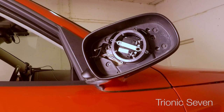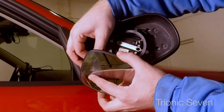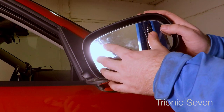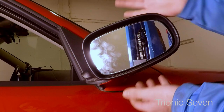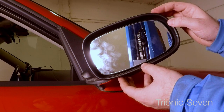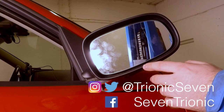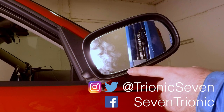Now all that's left to do is to put back the mirror glass. First we attach the heater wires and they just slide on. This is the mirror glass we salvaged and not the one that was originally on the car. And supposedly you just push it back on and the clip will snap on. Super easy to put back - I guess that's modern production technology. It's made to be really easy to assemble in the factory and then they don't care about how difficult it is to remove. So that's it - I'm calling this a repair well done. Thank you very much for watching. If you have any questions or comments, leave them down below or check out our Saab community Facebook group. I'll see you guys in the next Saab video.